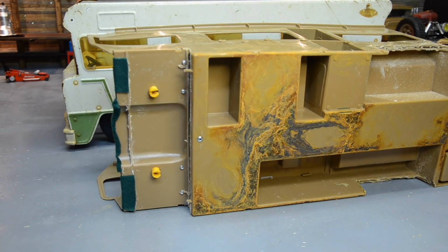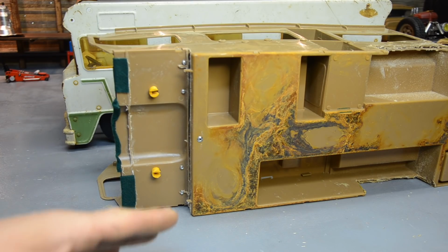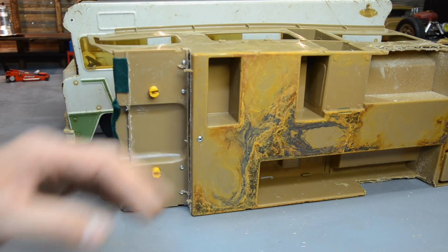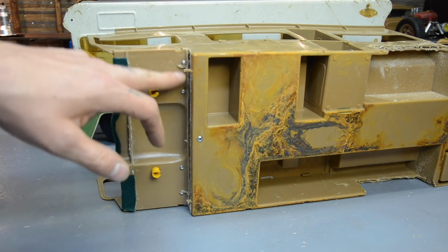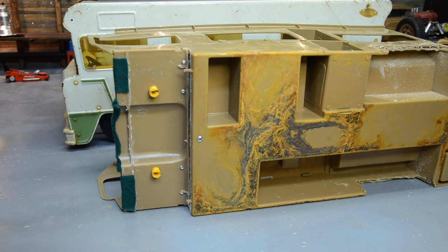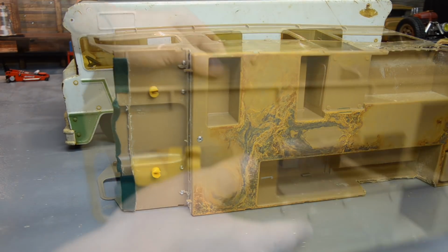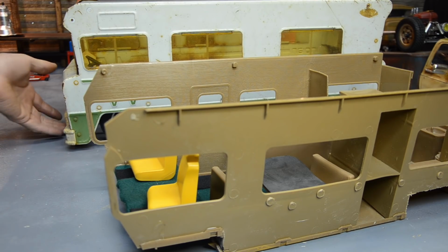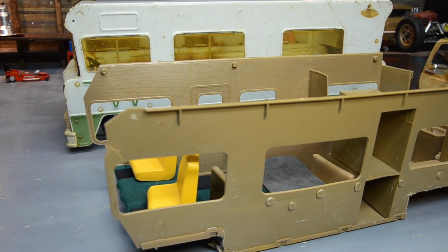And if you notice, everything I did on the underside of the Winnebago, I put the smooth side on the inside. So the screw and the nut are on the bottom. And then same down here, I popped the rivets long ways here, but over here, I got the smooth side down. And that is so the interior will still fit nice and flush on the metal floor, and it won't have any fitment issues. So I'm going to go ahead and throw this interior in, and we'll kind of piece it back together for now, since we've got to wait on a new transmission.